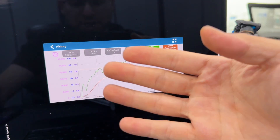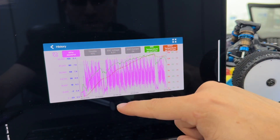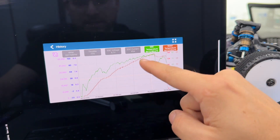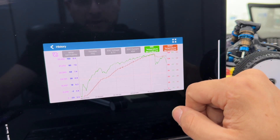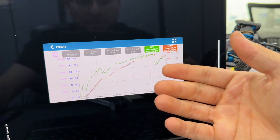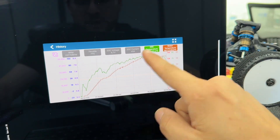I was also able to change a bit of the gearing and check out the RPMs. That's something we'll talk about in a different video, but you can see all the different RPMs throughout the stages of the run. With the fan repositioned, 150°F was the hottest I saw, compared to 205-220°F with the old fan position. Seeing raw, tangible data on all of this was super important to this test. Hopefully this showed you a little bit of how to utilize more of your Hobbywing features.